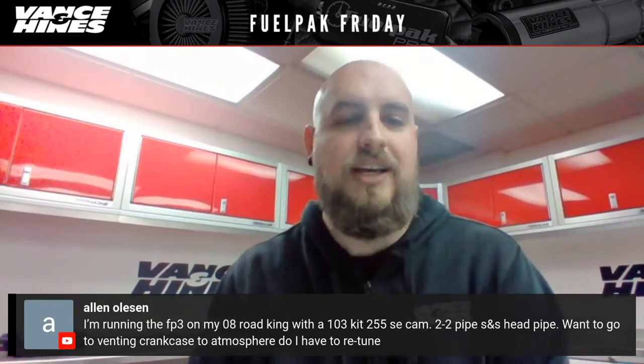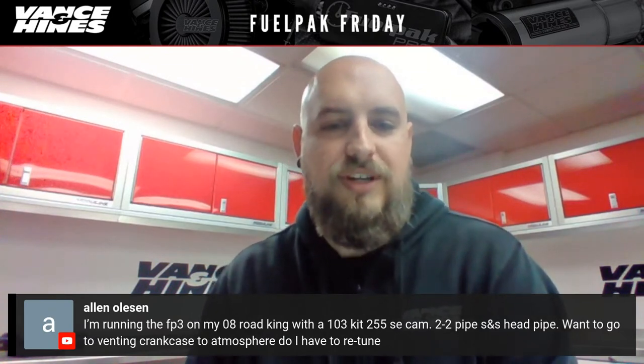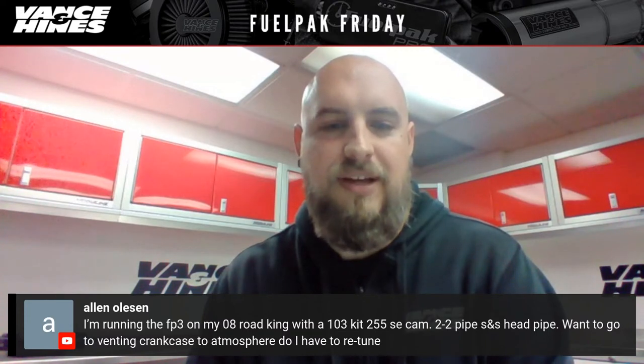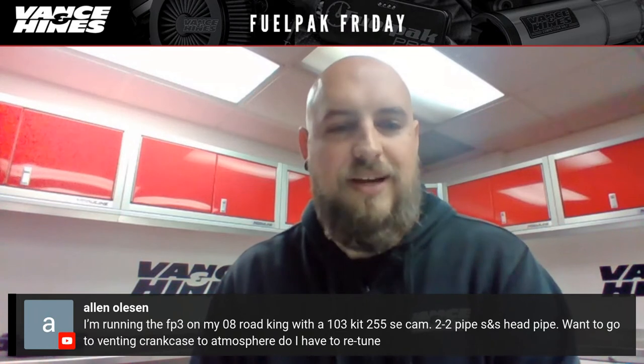All right, Alan Olderson on YouTube asks, I'm running an FP3 on my 08 Road King with a 103 kit, 255 Screaming Eagle cam, 2-into-2 pipes, and a head pipe. Want to go to a venting crankcase to atmosphere. Do I have to retune? Nope, don't worry about it.